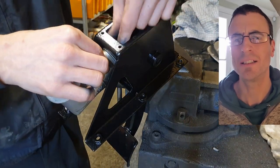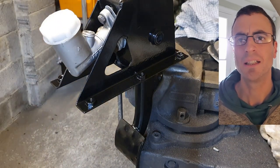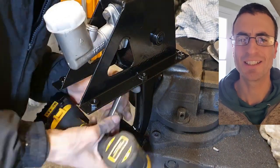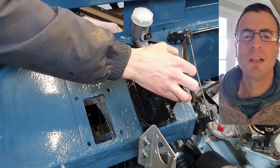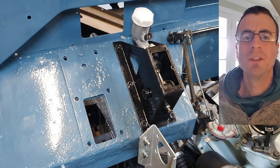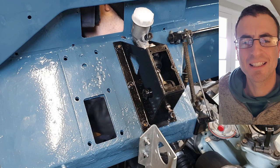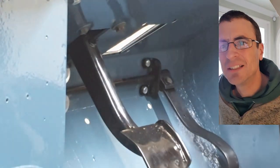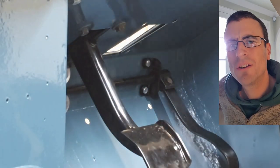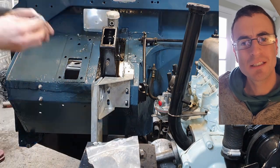This is the clutch going together. The cylinder I took off was new just a few years ago, so with that cylinder in place it went together nicely. I get it on the vehicle using my tools to tighten up the bolts — very satisfying. There are just six bolts underneath that hold it down, and there's one connection to be made since it has an integral reservoir. The original solid line had no rust at all, so it went back in. I tighten everything with the impact gun and then a spring goes on underneath too.